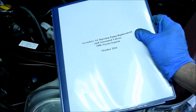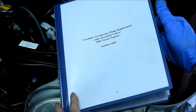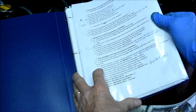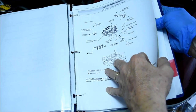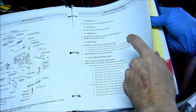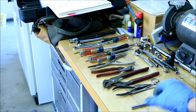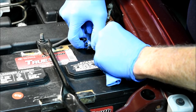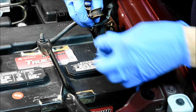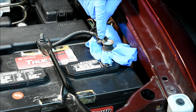When doing a project as complicated as this, I usually copy the relevant pages out of the Toyota manual plus any other information I think I'll need and put it in a little notebook. The first couple of pages are a brief summary of my plan, and then the actual manual pages follow, divided into the engine section and the emissions section. I also pick out the tools I know I'll need and lay them out in a logical fashion near where I'm working. Before we get started, we need to remove the negative lead from the battery. I often take an old rubber glove and put it on the negative pole, then put the lead back on to prevent accidental contact while working.